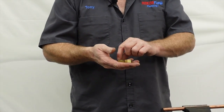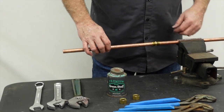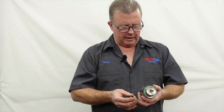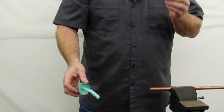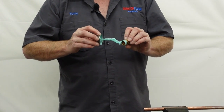I'm going to teach you guys how to actually do this the proper way. One of the things I like to do — which I find comes from my mechanical experience working on motorcycles and cars — is using anti-seize to make sure I get a nice even torque. So I use my green stuff, my all-purpose thread sealant. In this case I'm not really trying to seal anything; I'm using it more as a lubricant and anti-seize agent to make sure I get a nice even torque on my compression fitting.